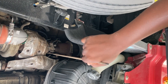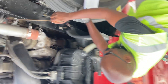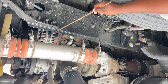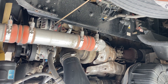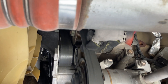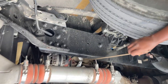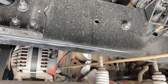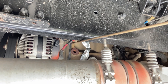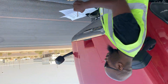The exhaust system is not cracked, broken, or repair welded, and there's no black soot, which would indicate exhaust leaks. Here we have my alternator, properly mounted with bolts that are present and tight. It is not cracked, broken, or damaged, and it is belt driven. My belt is properly seated — it's not cut, dry rotted, broken, or frayed, and there's no more than three-fourths of an inch of play from the center. My alternator wires are properly mounted to my alternator — they are not cut, spliced, bare, or frayed, and there's no indication of tape on my line. That takes care of the passenger side.